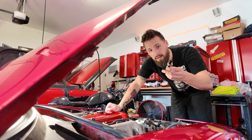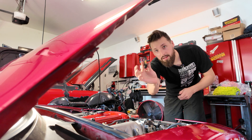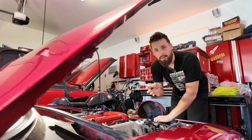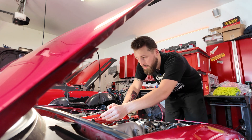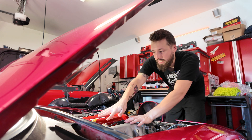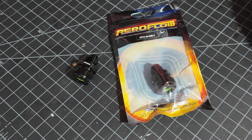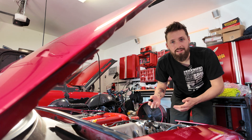Hose comes off. We need to remove this barb - it's old so it's probably really on there. There it is - that's your PCV valve. You can probably hear it too. That's a little ball valve in here that allows the vacuum to open and close this whole system. We'll put that back in the valve cover, make sure that grommet stays in place. Now we have that separated. We've got these really cool adapters that allow us to attach them to a barbed fitting, and then we'll run AN fittings. Let's go figure out why you might want AN fittings and how they work.